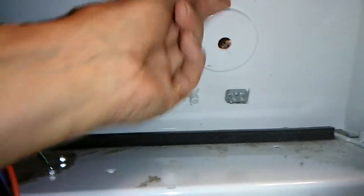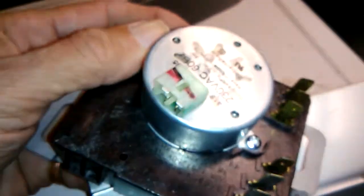It lives right back there. It's held on by two compression clips, so you've got to take a pair of pliers, reach in there and squeeze the compression clips and they'll come out without too much trouble. They only fit one way, so you can't screw them up. There are two connectors — you can see the prongs — they connect right there.